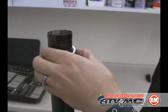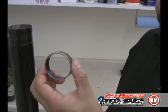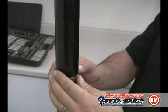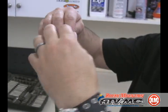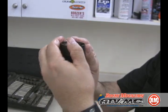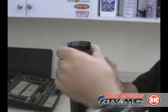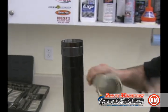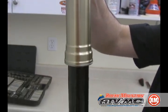And we're going to go ahead and put the washer on. Sits on your seal. The outer bushing, it slides down also. And then the inner bushing. And the inner bushing, you might need to spread apart again and slide into that groove. Once all that's installed, it's time for the outer tube. I want to make sure that's nice and clean. Slide that down.